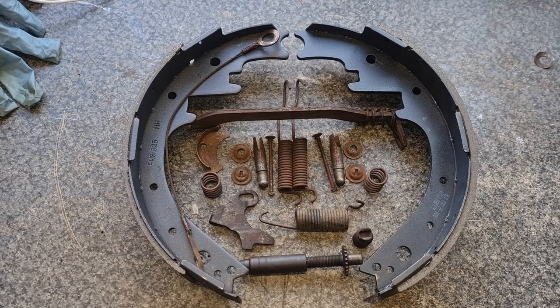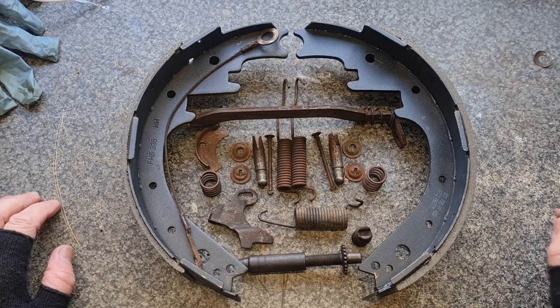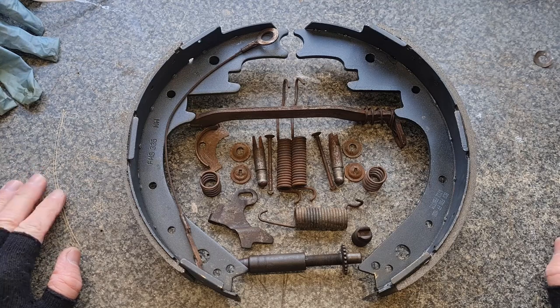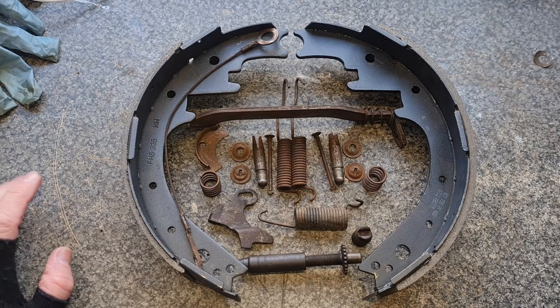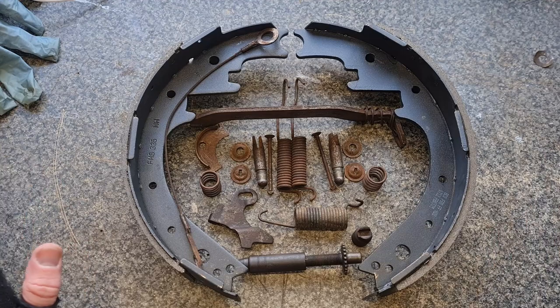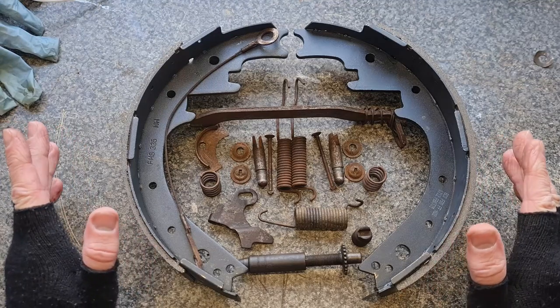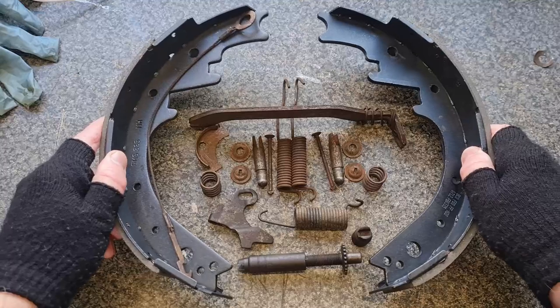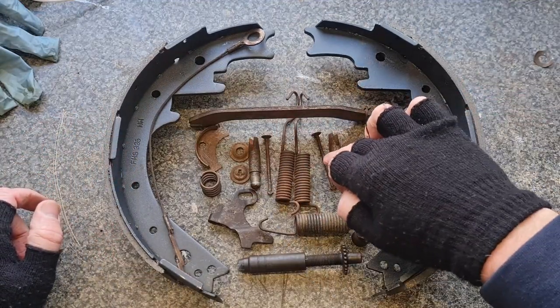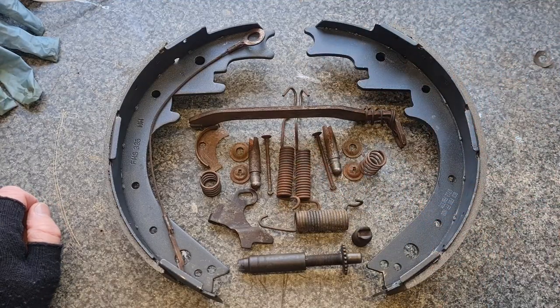Right, I'm going to clean up the backing plate, change over the wheel cylinder, and then we're going to do the rear seal. There's all the bits cleaned up. Now I wanted to show you something I noticed from when I did the '72 New Yorker old blue rear brakes — there is a slight difference between the '72 and the '66; they changed it over the years. Everything you see here is universal basically — left will fit right, right will fit left — whether it be the springs, the wheel cylinder arms, everything. It's all universal with the exception of a few parts.